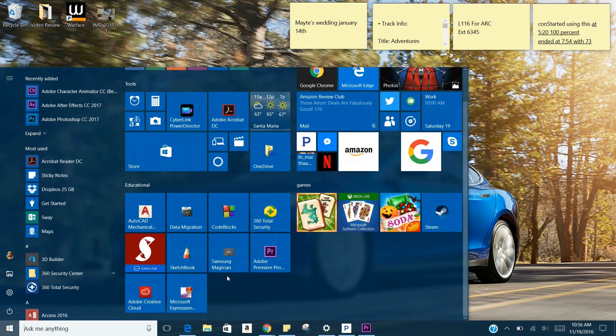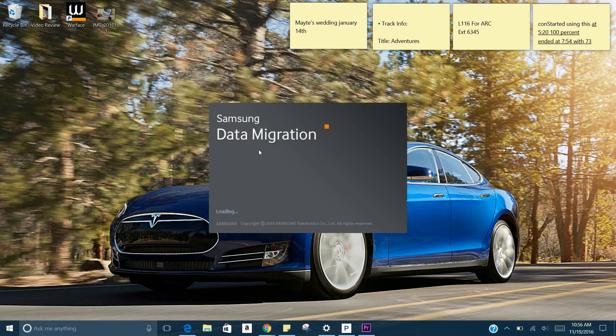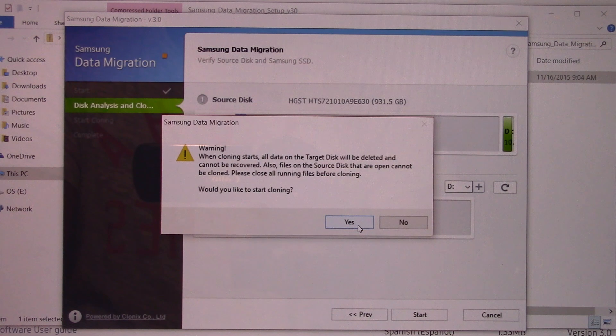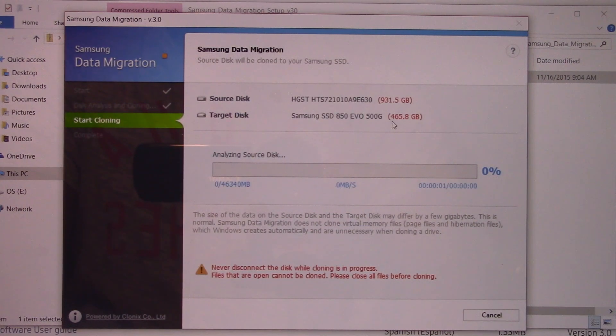After you finish installing both programs, go ahead and open the Samsung Data Migration software. The process took about 30 minutes to migrate the data from my hard drive to the SSD — I only transferred 42.3 gigabytes at 26 megabytes per second. Don't forget to re-enable the firewall once you've swapped in the SSD. Another good tip is to start with a clean Windows installation, because with some updates like the anniversary update, partitions may not all be copied and your laptop won't boot. This happened to me with my Dell laptop — I got the migration successful message but the laptop would not boot. As long as you don't have more data on the hard drive than the SSD can hold, the Samsung Data Migration software should take care of everything.